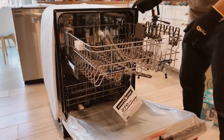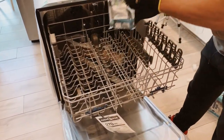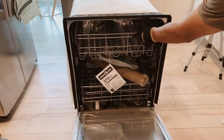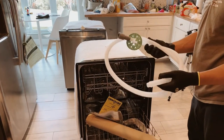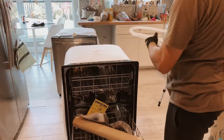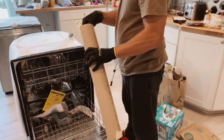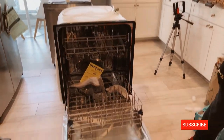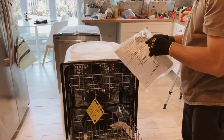We're going to have to move some cables from the old dishwasher and attach them to the new dishwasher. We have all these foam pieces — we can go ahead and take them all off and set them aside. There's also some cleaner for the dishwasher. We got our hose — this is the drain hose which we're going to use, though we'll see if we have enough once we get to that step. This is probably the handle for the dishwasher — we'll put that on last. We have the manual, some hose clamps, and the clips to secure the dishwasher to the countertop.